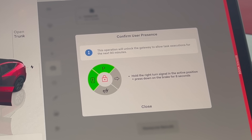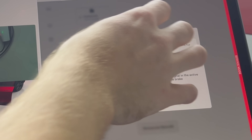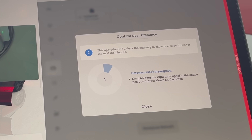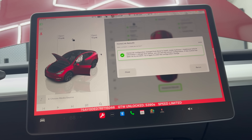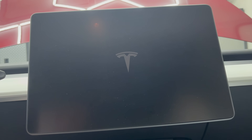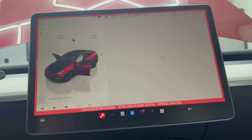Now you're going to need to pull the park button plus the blinker. Put in your passcode if you have one and it's going to unlock. Then hit Home Link Retrofit — it's going to run its tests and install it. You'll see a green 'Successful' icon. The screen may automatically go to a restart mode and it actually restarts itself a couple of times on this 2024 Model Y — I didn't really have to touch anything.